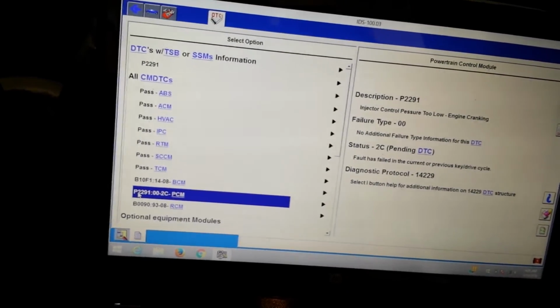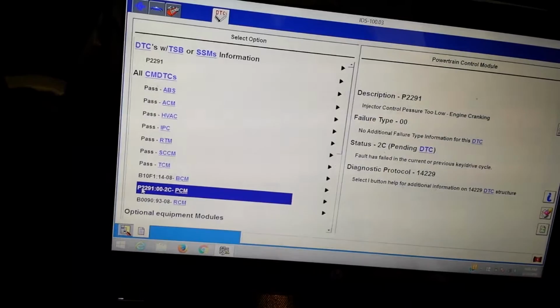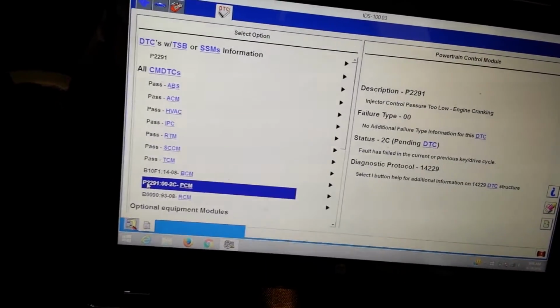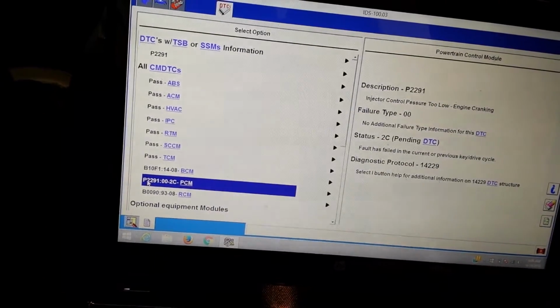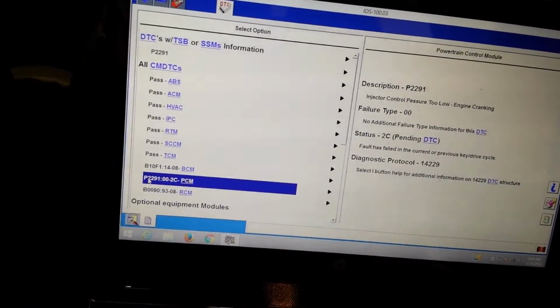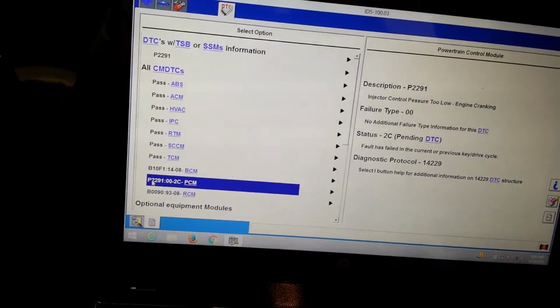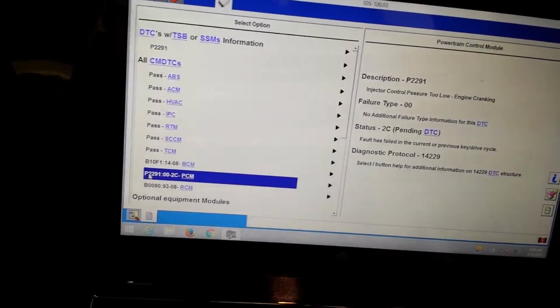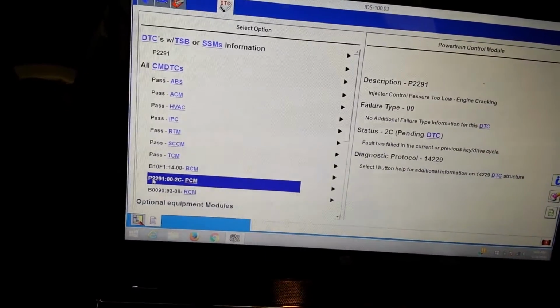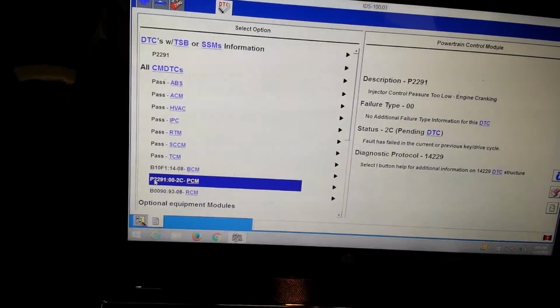So what we're going to do is get all the fuel out of it, put some fresh diesel in it, get diesel up to the point where I'm at on the upper filter, change the fuel filters, and then just start up and let it run. It can't hurt anything. If there's damage that's been done, it's been done. If not, sometimes you get lucky and they run fine forever. So we're not going to condemn the whole fuel system right away. I'll check back with you after I get some of this fuel out of the chassis.